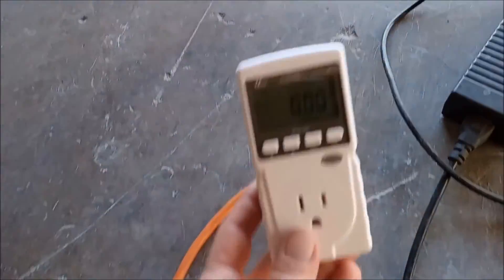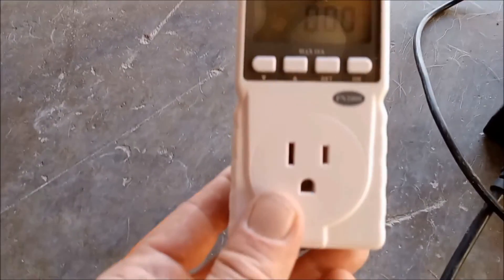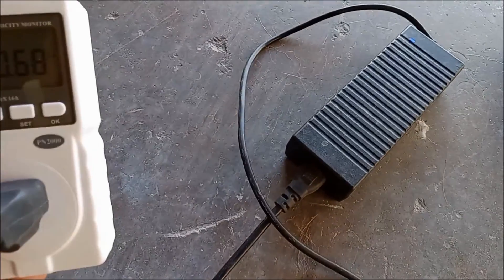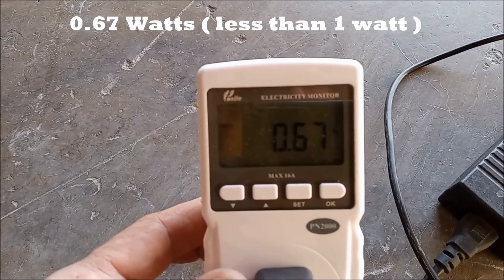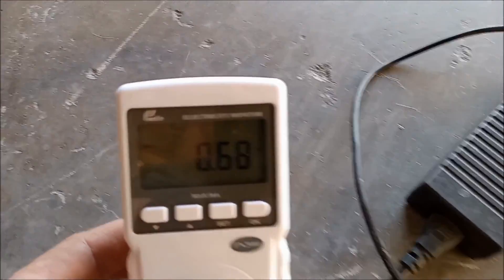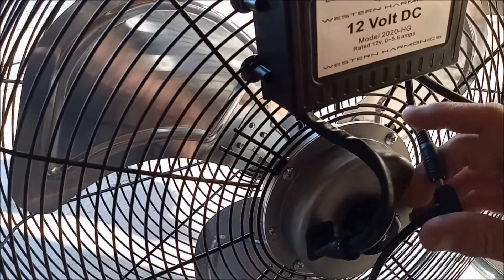So what I've done, I've gotten out the watt meter, or the usage meter. And if you can tell, I've gone ahead and just connected this to the extension cord. We've got power going to it. We're not using anything right now. I'm going to go ahead and plug in. I've gone ahead and plugged in the wall adapter. We have power and we have this phantom usage. This is actually the usage that the device uses to power itself, making that little blue light right there be turned on and power be available and ready for the fan. So I'm going to go ahead and connect to the fan.